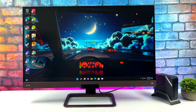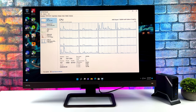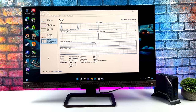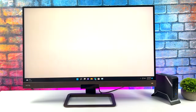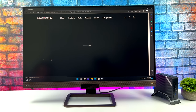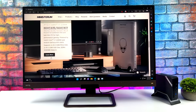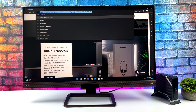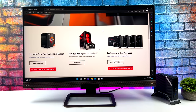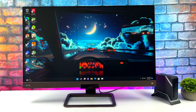So I've had a little time to mess around with this, and the APU is actually running at 35 watts right out of the box. You can always use a third-party application like APU Tuning Utility to up that TDP. Everything's been working out really well. Picking something like this up as your everyday PC or secondary PC is going to work out perfectly fine. That 5800H has more than enough power for web browsing, email, document editing, 4K video playback, 1080p video editing, or even photo editing. With those eight cores, 16 threads, and boost up to 4.4GHz, running at 35 watts it can keep performance across both the CPU and GPU at the same time.